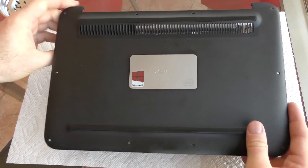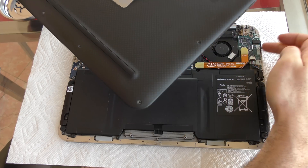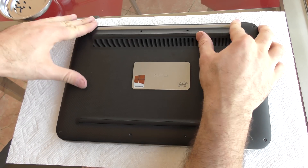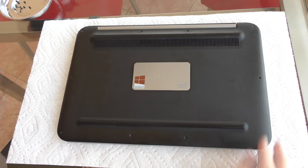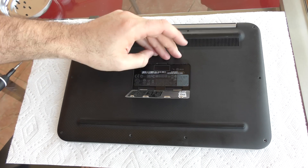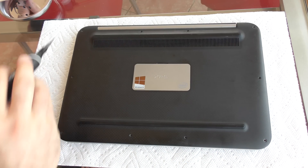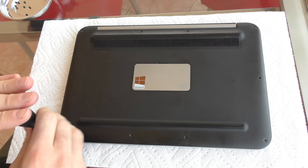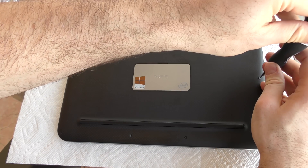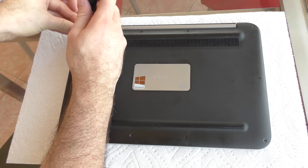Next, replace the plastic back plate. Make sure that the plugs and ports here go in first. Place the screw under here, and then replace the 10 screws that go around the perimeter. For people who are OCD and wondering why I don't put the screws in sequential order, that's actually on purpose because that helps them all get seated evenly.